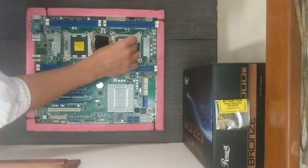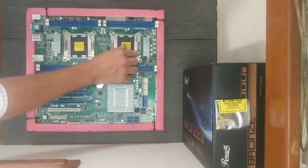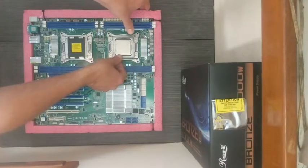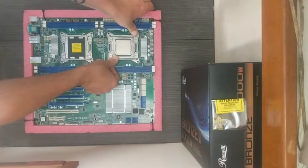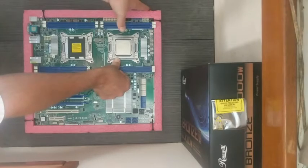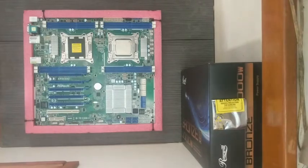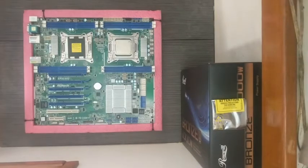Then move the latch back over. This will pop up. We then load the two keys. Good bit of pressure. The round should go in second. The straight can't go in without it. And now the CPU is fully set. It only wants for its cooler on top.